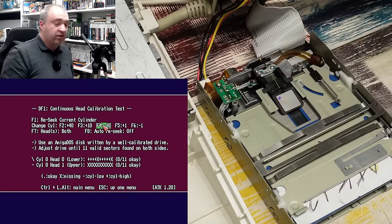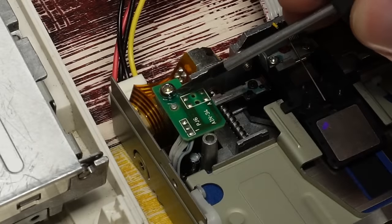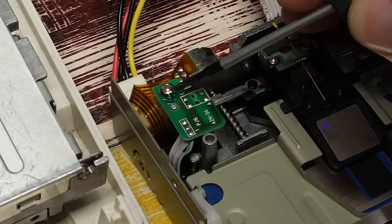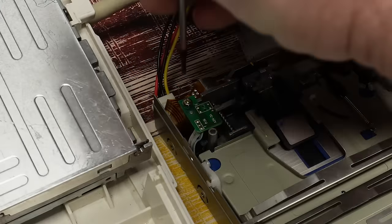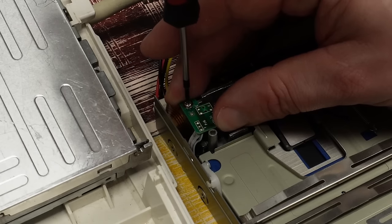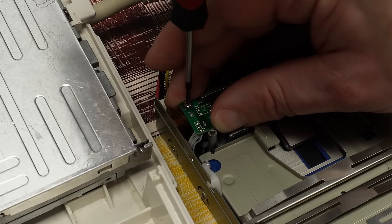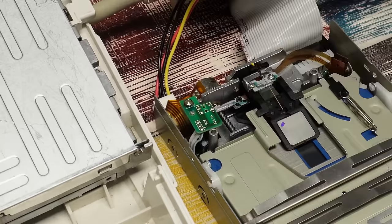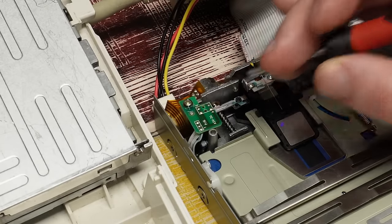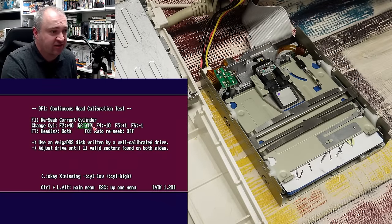If we look very closely at the glue on this, there is a bit of a ridge in the glue just at this point, and then the glue on the screw sort of stops back there. That makes me think — I'll just loosen that again slightly and give it the tiniest movement. Really what we're trying to do here is just move everything back into its original location. The ridge of glue coming off the screw, going down onto the PCB, seems to be almost in a straight line now. There's obviously a lot of guesswork involved here — let's just see what that does.